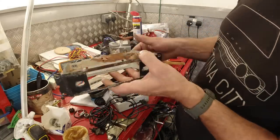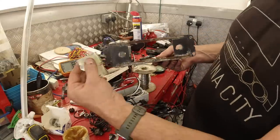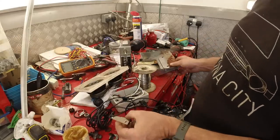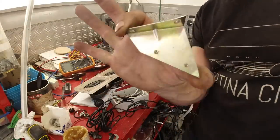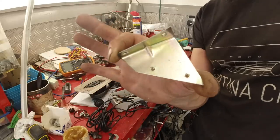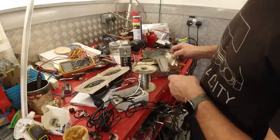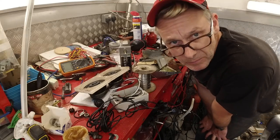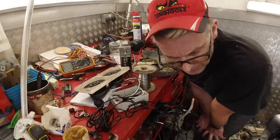You've got about five mil between the radio and the speaker - very close, but it does work, I've done it on all my cars. We've got the chassis now to fit. We'll pre-fit the radio into this - you have these brackets here which fit at the side and secure it. They're needed, or you can make them - they're the radio installation brackets. If you've never had this type of radio setup you'd need those.